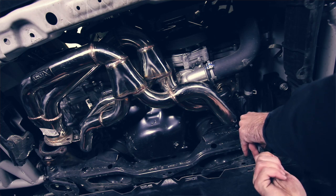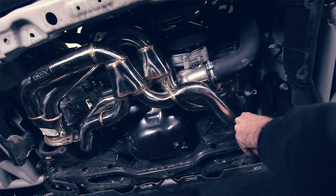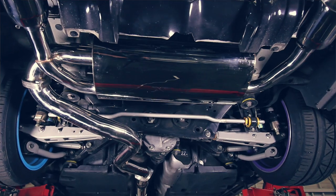After that we took the car back to standard, fitted the extractors and the 3 inch cat-back exhaust system, and put it back on the dyno to see what just the exhaust components will give on their own. These components gave a smaller gain of about 5 kilowatts at the rear wheels. What was noticeable straight away though is the car now had a nice aggressive exhaust note.